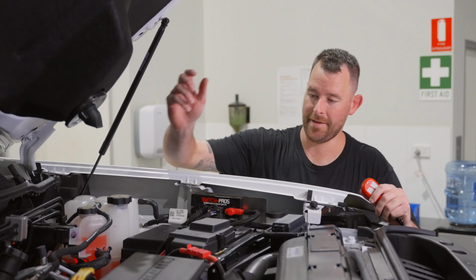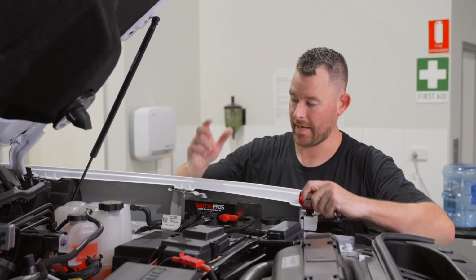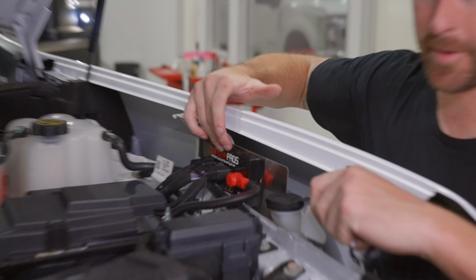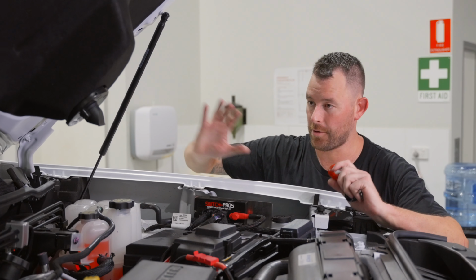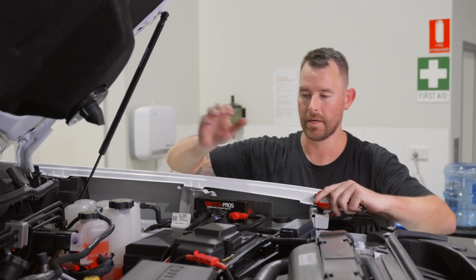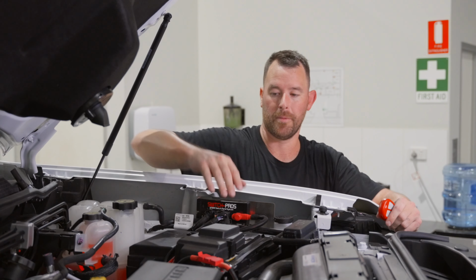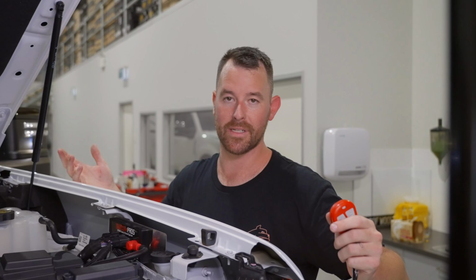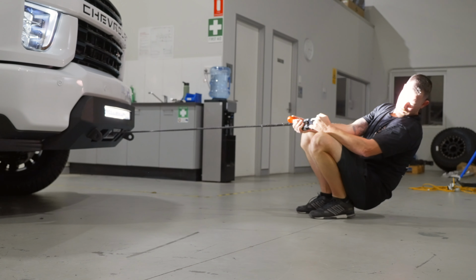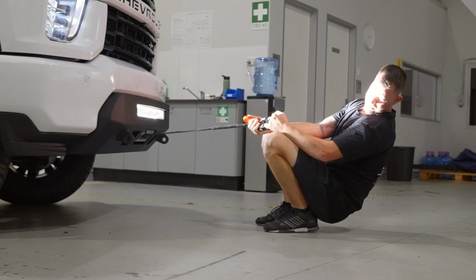Under the bonnet there, you've got your isolator for your winch, got the controller ready to rumble, and under here as well is the Switchpro as we showed earlier. So nice, neat under bonnet solution here for all of the switching needs for the vehicle. Keeps the engine bay super nice and tidy. You've got another couple of little MIDI fuse holders for your rear Anderson plugs. That's as simple as it is. That was a whole lot of power.